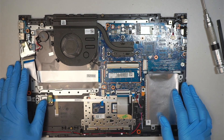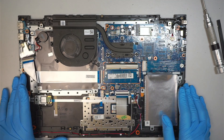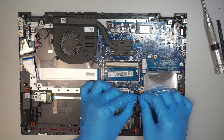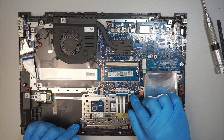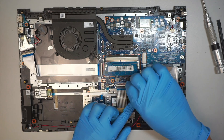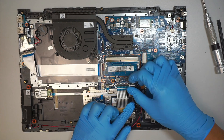Once you're done with that, let's disconnect the keyboard and the trackpad. Here, slide the connector down towards your body — that is your left and right speaker connector. Here is your touch ID fingerprint sensor. Open up the clipper and slide the flex cable down. Open up the black clipper, flip it open, and slide the keyboard cable down.